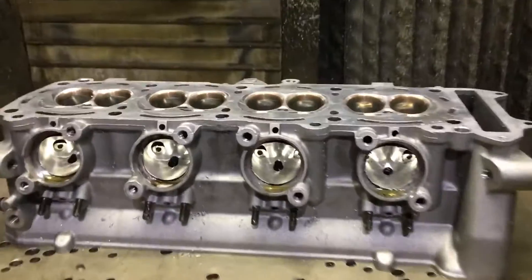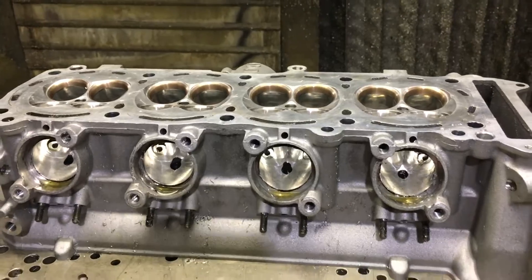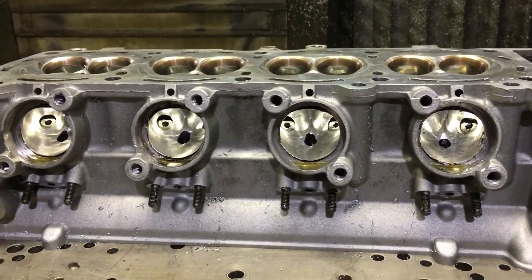The great part about that is — if you have a 1300cc Gen 1 and you bore it to 1397, we'll call it a 1400, that's 100cc, that's 6 cubic inches. Your bike is making close to 2 horsepower per cubic inch, so you might see maybe 12 horsepower from that bore. But you're actually making the engine less efficient by making it bigger without making it breathe better, and that'll cost you more in labor and as much money as the cylinder head would.